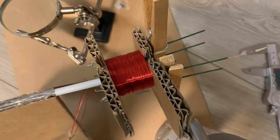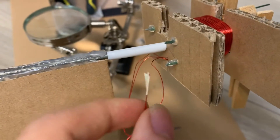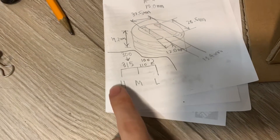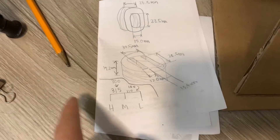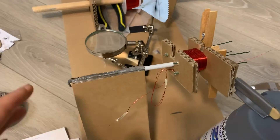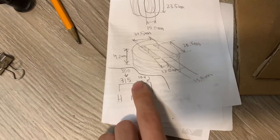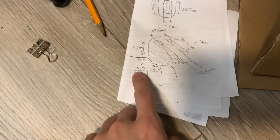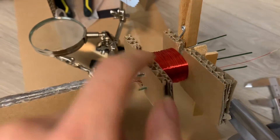Here's the final result for the new speed coil — I just finished winding it. Here you can see the high-speed tap, the medium tap which consists of two wires because that's where the two coils merge, and the low-speed tap. I counted the turns when I originally took the original coil apart — there were 300 turns to begin with. But because this fan is going to be running at 120 volts rather than 110 as stated on the motor tag, I increased the turns to 315. Same goes for the medium to low — it was originally 100 turns, but I put 110 turns. So it's got a total of 425 turns of 29 gauge magnet wire. I'm going to carefully take this off the winding tool and wrap it up.